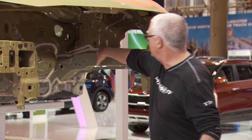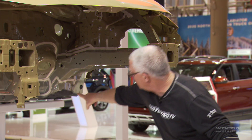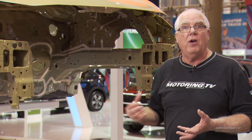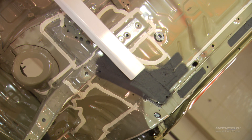You can also see these white lines around the car, which are sealer. That sealer prevents moisture and bulk water from entering the body of the car, and it's applied to all the lap joints around the car. You can also see that coating back there is a sound deadener, which also has the secondary effect of preventing stones from chipping away at the body.